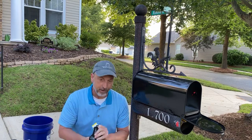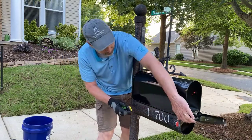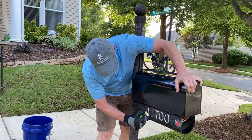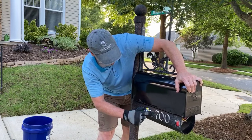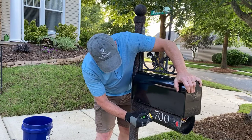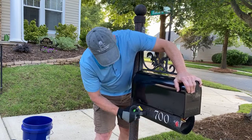And also try to use a glove just to save a little bit of hand work there, and show you how it works. Now, if you grab this box, you want to make sure it's nice and stable. And then you get under that number, and you can see how easy it is to pull off. Now I'm having to apply some force, but overall, you can see how the number just came off almost altogether. Sometimes you'll get a little residue, so I go back over it. You see it right there. And you can see the plastic razor blade doesn't do any damage to the paint itself.